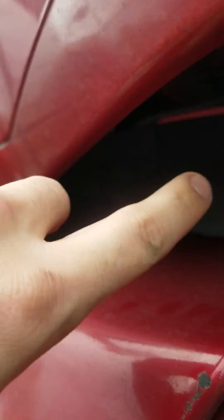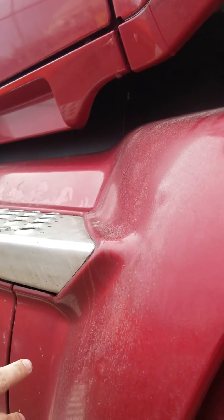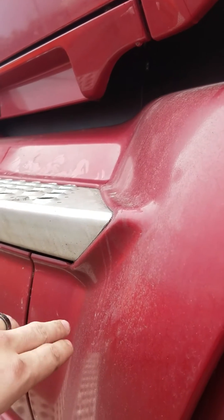Up under here is where the battery cables come down — the cables to the power inverter. They come down in through the battery. Don't hook them up to the battery just yet; you're gonna have to run your wires first. I ran them up under the cab, just underneath this little fairing right here, and kind of zip tied them where I could.